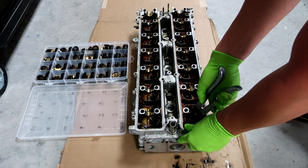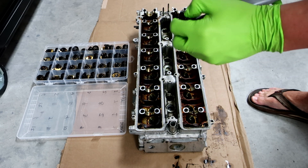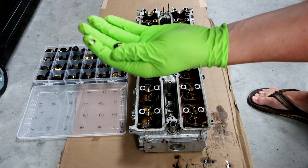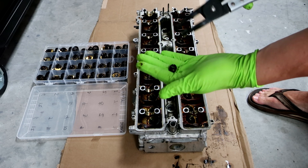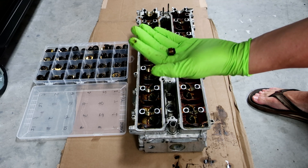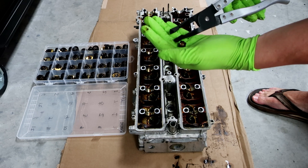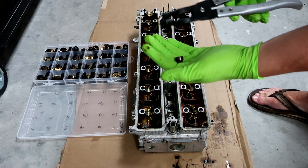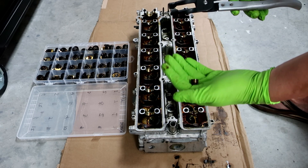So you want to grab it here, guys — pull up — and there's your seal. That's your little seal right there. It just pops on there, just like a little rubber grommet. The reason you replace this is it keeps oil from getting down the head — and that's when your car starts up and smokes. These little bastards cause you the headache. I'm not getting OEM ones; I'm getting ones from a company called GSC — the same thing that's in my personal Supra. They're like $16 shipped. But to get these out is a ton of work, so if you're in there, just replace them. They're not worth keeping.